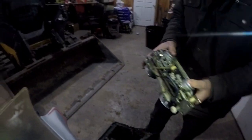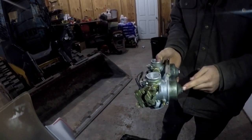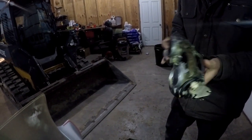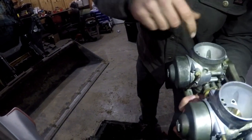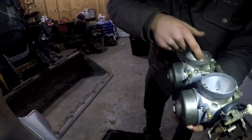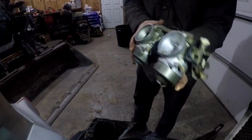The main focus is actually going to be removing the air box, but I want to just follow up with our carburetors. If you guys watched part one, we basically had the carbs disassembled. I had Sully finalize the carburetors — he put all the new jets in, put the new bowl gaskets on, put the new main jets in. He boiled it in the ultrasonic a few times. You can see there's a little bit of residue yet, but they came out very clean — sprayed clean through all the air bleeds, choke port, everything was flushed.